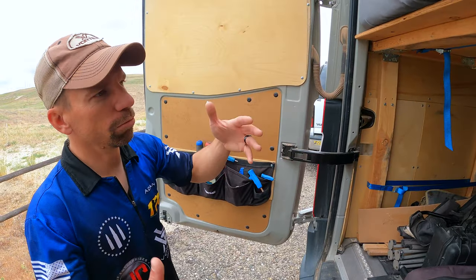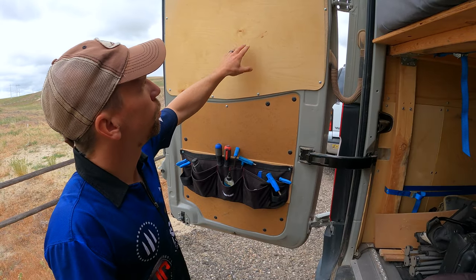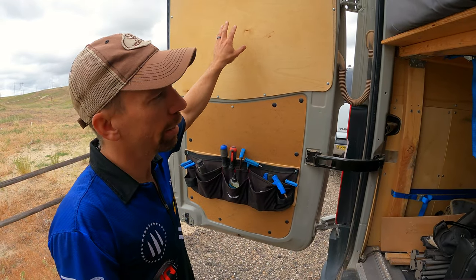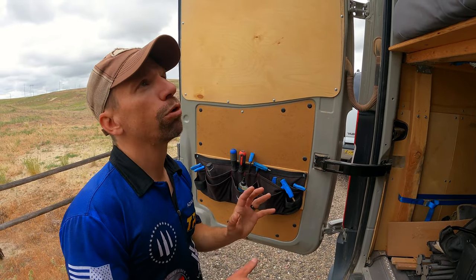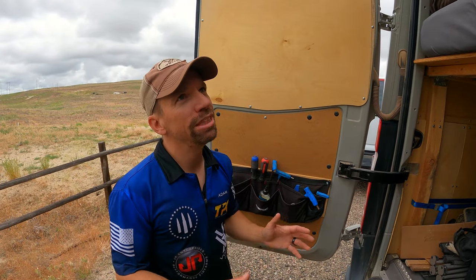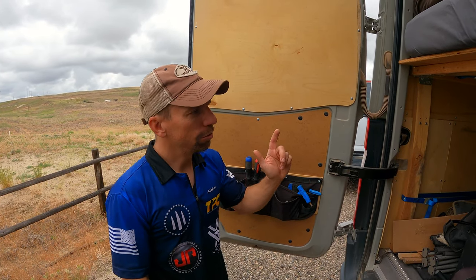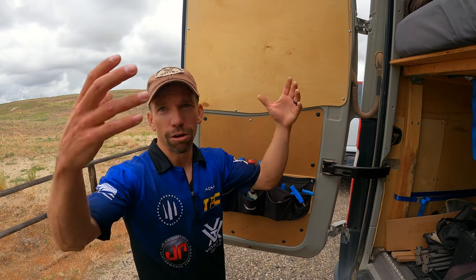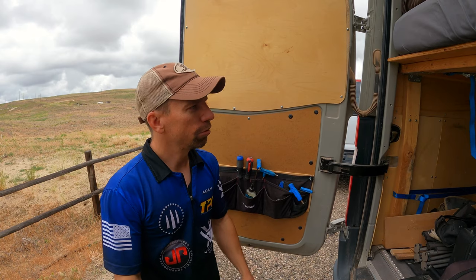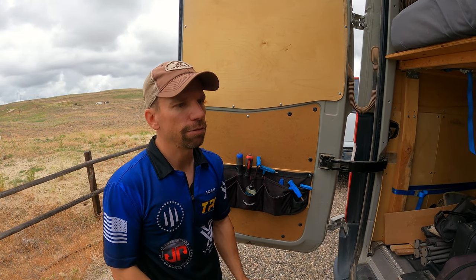This was originally a full box fan area — there are just indents where the windows go — so we put paneling over those with insulation behind them to keep everything cool. It works pretty well up until about 95°F. You can run just the fan portion of the heater and it pulls cold air from underneath the van up through the middle, which sort of acts like AC.